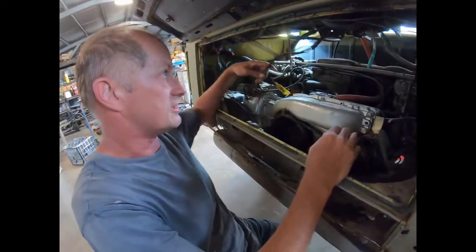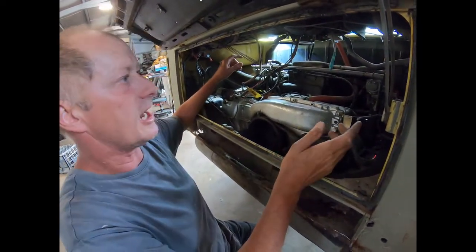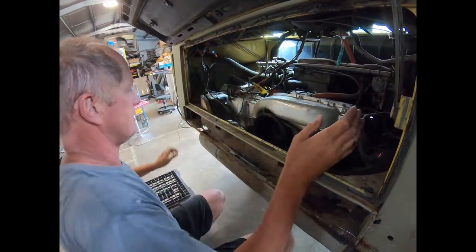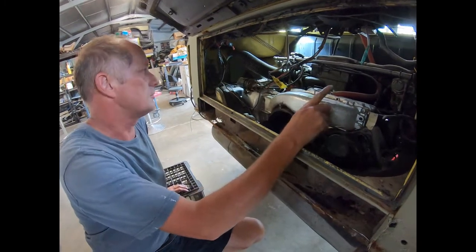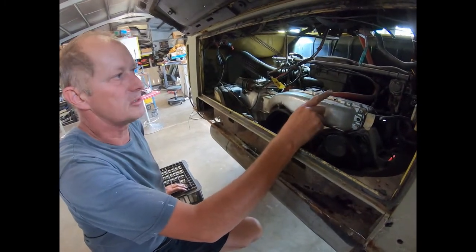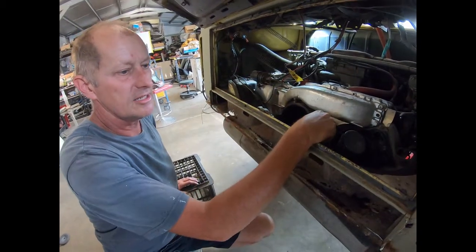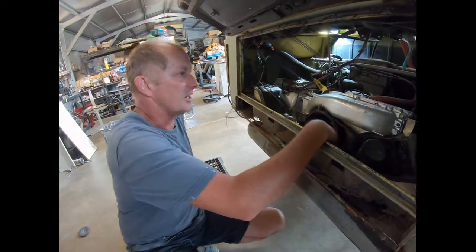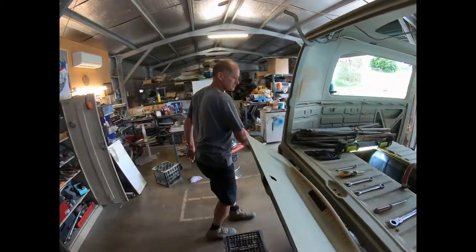Because we've got a few wires to disconnect from the motor itself, let's start with doing that, all right? And we'll get to the fuel section later because we need to disconnect the fuel from where the fuel lines come into the back of the motor and make sure we plug the hose there. If you can do this job with the tank empty, it's even better, but I think there's a little bit of fuel in this one. We were driving it around, so.